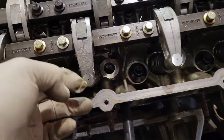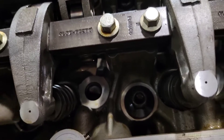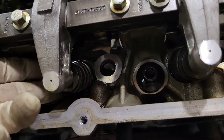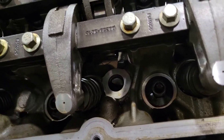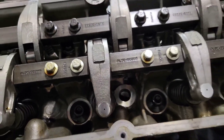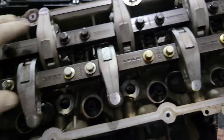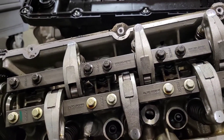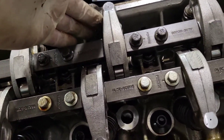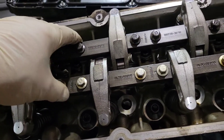On this one the valve is probably going to drop because we have a sealing issue on this cylinder — that's why we replaced the engine. They drove it a lot of miles with a broken valve spring. We tried sealing the valve and couldn't get the leak down to change, indicating the valve dropped and hit the piston or damaged the cylinder head. We're going to remove both rocker assemblies to make sure the valves are closed — if your intake valve isn't closed the valve will drop.